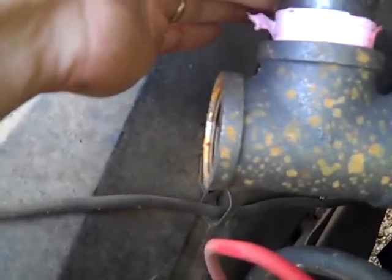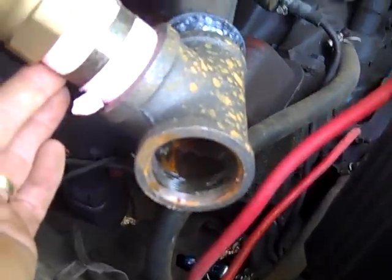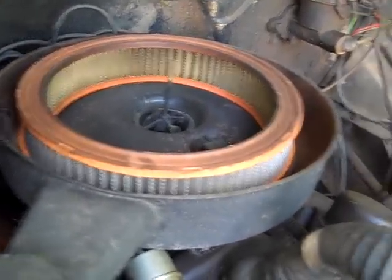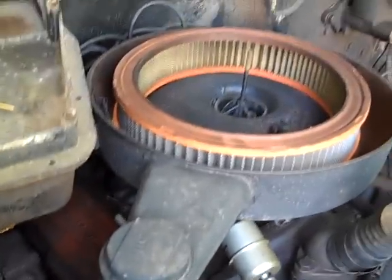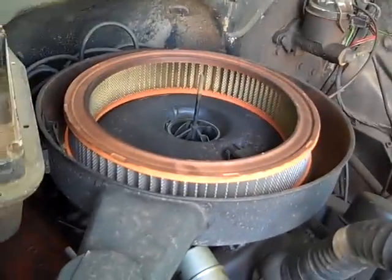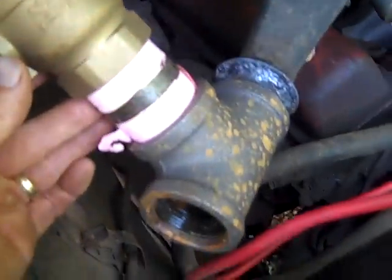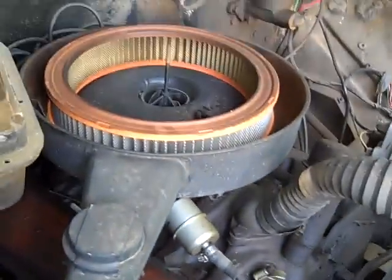This will be my air valve so I can quickly adjust it by hand, and then I'll bring the wood gas in here — just bring the hose in and hook up right there. I'll put the lid on top, it's got a good gasket. I've tested it and if I shut these things down the truck chokes right down, so it's definitely sucking through here pretty good and should pull the wood gas in. We'll try this probably tomorrow — one step closer to running the old 283 off wood gas.